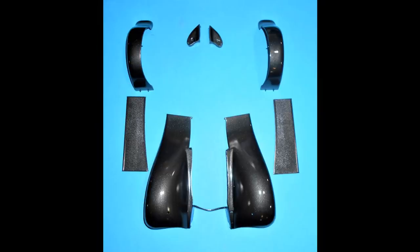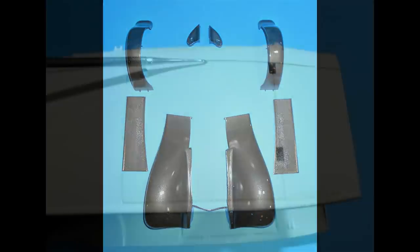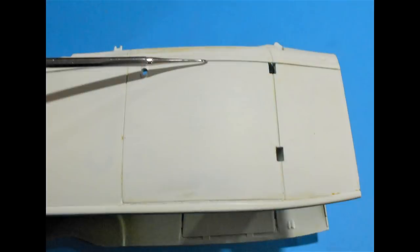It's the 1832 Blazing Black, and with the metallic flake in it, it gave it kind of a grayish tint, so that it wasn't pure black, but I thought it would complement the other color on the body. As I mentioned, there's another color on the body, and I find that it's kind of helpful to scribe your line if you're going to do a two-tone paint, so that you can get a nice clear cut of the tape, your masking tape, after that's all painted again.